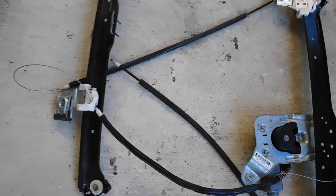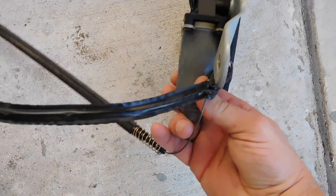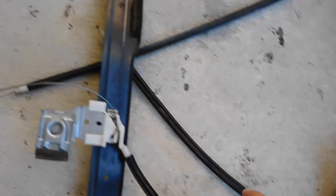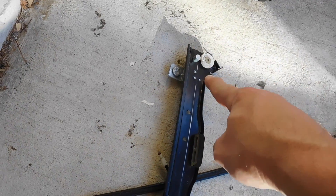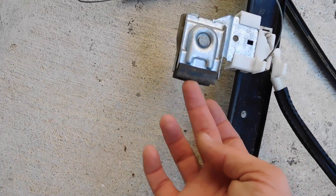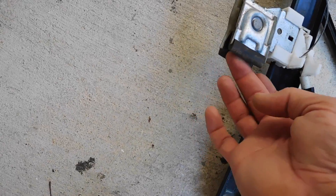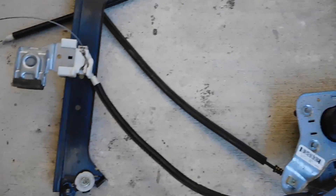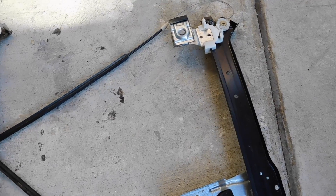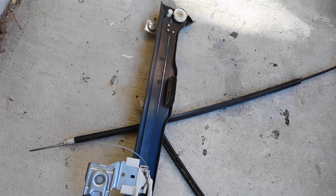Here's what we're looking at. Here's the old one — you can see it's kind of a mess. You've got the window regulator here and cables — little steel cables that run through, go up around these little pulleys, and run down to pull the window up and down. I tried to completely rebuild and fix it, but it was just beyond me. There's no way to really do it.